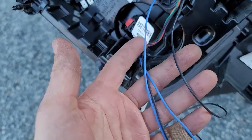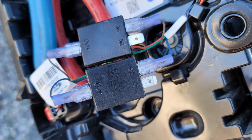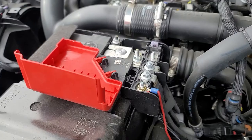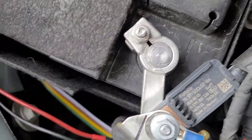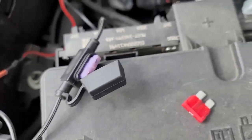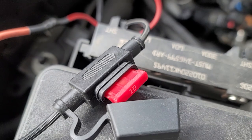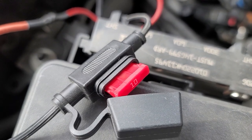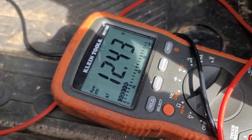The Blue Ox wiring kit has worked fine as well. My complaint is that there was no mention of needing to have the tow vehicle charge the Bronco. When I towed the Bronco for the first time, the battery nearly died. So you'll have to make your own battery accommodations and wiring depending on the type of connector your tow vehicle has. I basically just wired a hot and cold wire from the female receptor on the front of the Bronco to the battery with a protective fuse. I do think they really needed to include that.